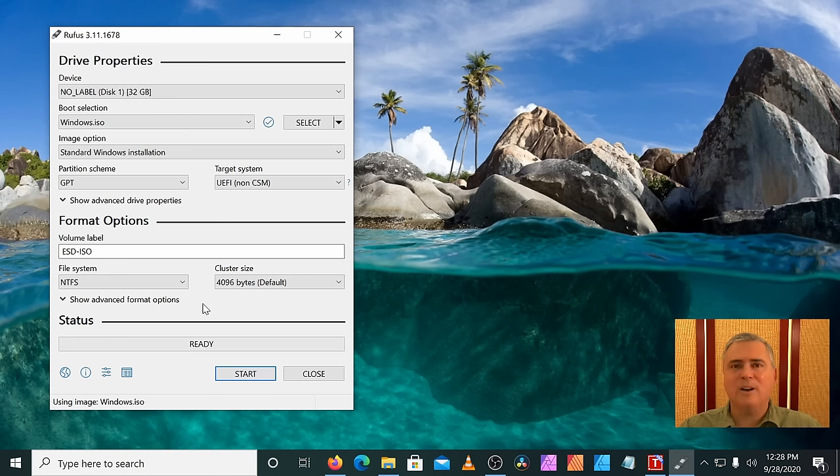We're going to start. I have a pretty fast system and USB drive so this'll take about three minutes. On a slower USB 2 drive it will literally take 10 times as long. When it's done, note that it says it has the UEFI NTFS bootloader on the FAT32 partition, and you must disable secure boot. You can disable it for the installer and then re-enable it after Windows has been installed.